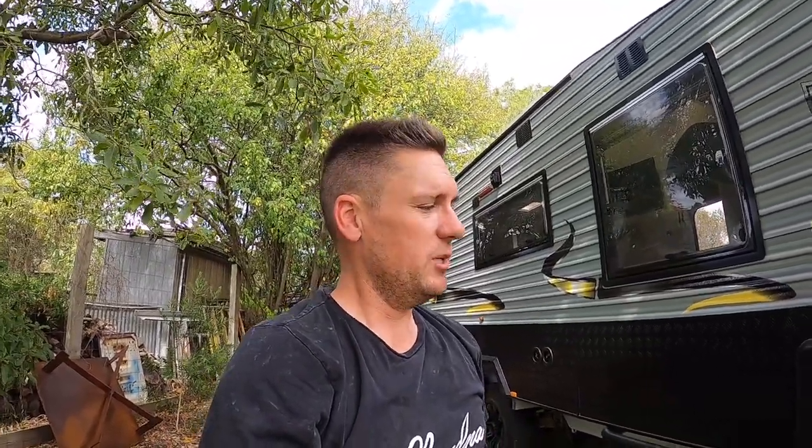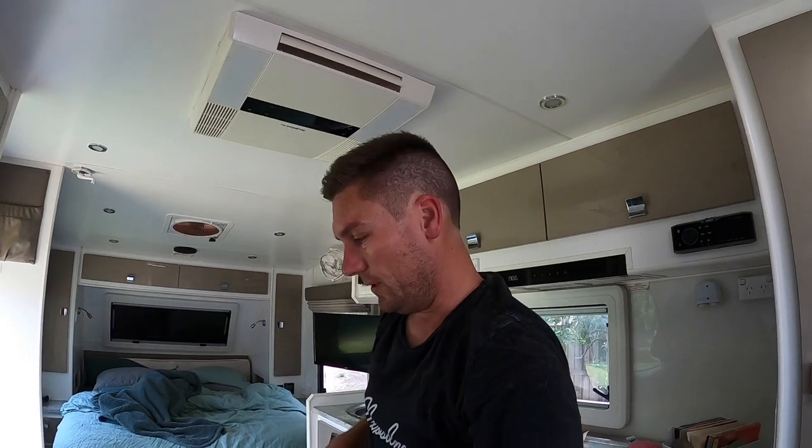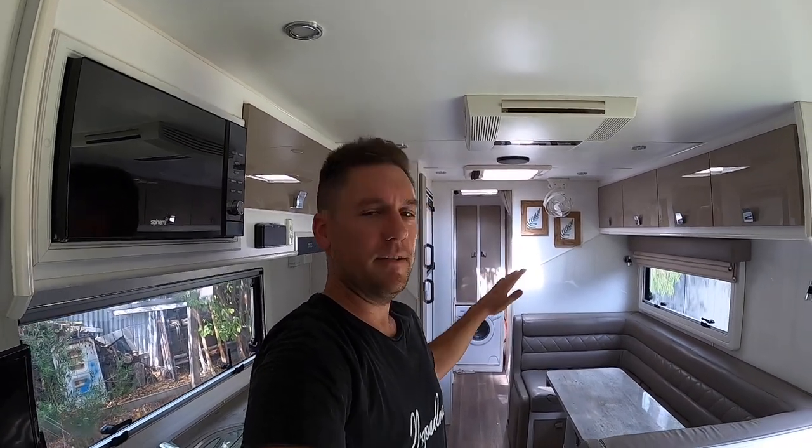These are things I've been working on the last couple of weeks — just tidying up. It's a secondhand van in not bad condition, but still got a few things to tidy up so we're ready to go and things aren't letting us down when we actually do go travelling. Check out this hole here — you can see how dirty it is, already got red dirt in it. The van's been cleaned but the problem's not fixed; you need to silicon up these holes. A little bit of maintenance like that — covering all the holes, getting everything working properly, securing anything that's loose or rubbing — is going to save you dramas down the track. It takes just a few minutes to climb under and have a look; if something moves and shouldn't, zip-tie it or p-clamp it to make it secure.